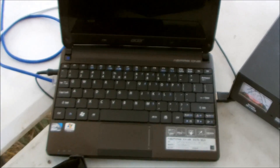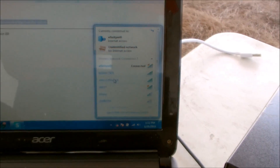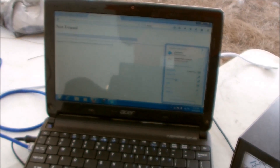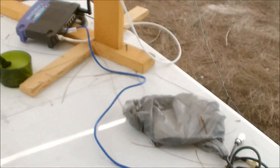On my laptop, I have USB in and Wi-Fi. What you have to do — you can Google it — is set up internet connection sharing. Basically you're sharing the wireless connection in your adapter control panel, sharing it with the Ethernet, and then I output the Ethernet into the Linksys WRT54G.